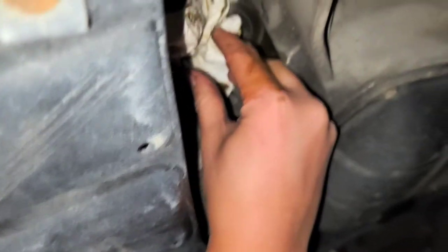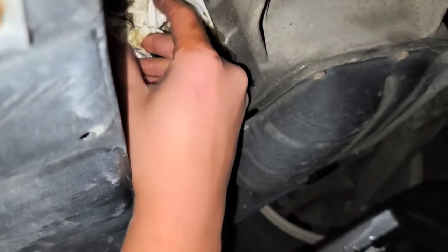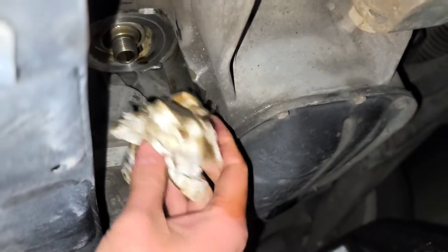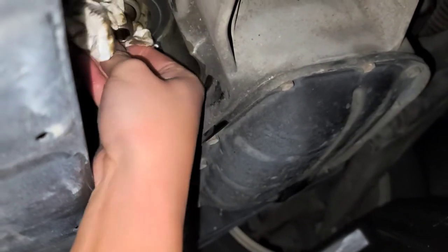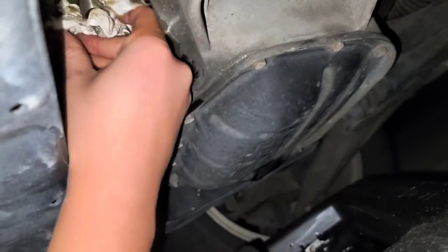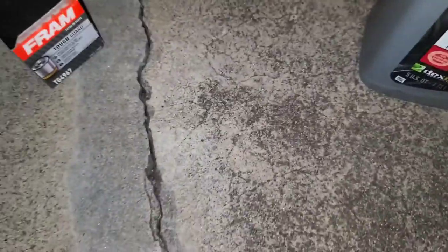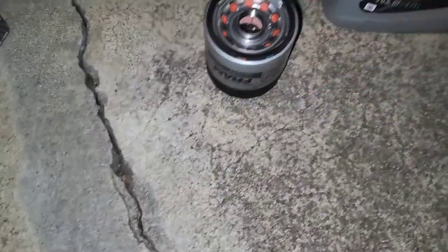Here I'm cleaning out the oil filter area with paper towels. It doesn't need to be super clean because the oil is just going to get gross again — just clean what you can. Then for the oil filter, move the drain pan back over and I'm going to get the oil to prep the new filter. You can use whatever type — I actually had a bunch of leftover Mobil 1 and poured them all together. Mixing different types or brands of oil isn't really much of an issue as long as you change it often enough.